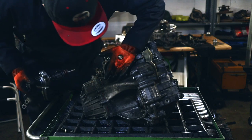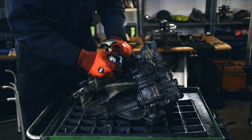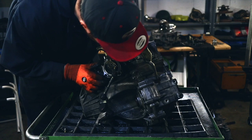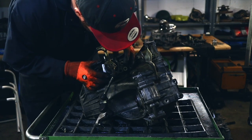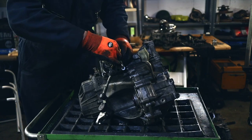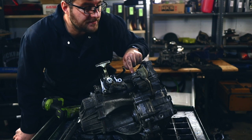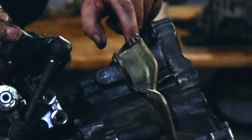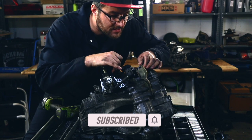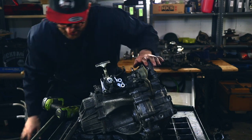Make sure to put all your shafts nice and straight, and put all of that in here like this. Check the alignment — there we go, like this, that's how it has to go in. Put all the screws back in. We're coming to the end here — I've installed the linkage and I need to make two holes here. I had to make two markings here to drill holes, because this part does not exist on the 2ZZ gearbox, so I need to install this, tap it, and it will be good.